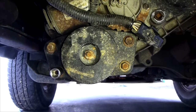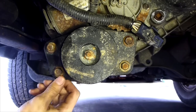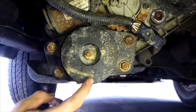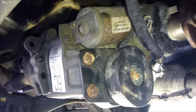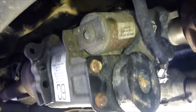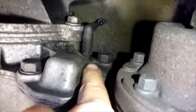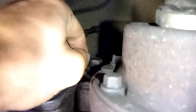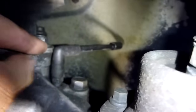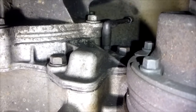So now we've changed out all the fluid — nice new fluid in there. Run it and see how it works; make sure you don't hear any noises and observe for any leaks. And that's how you change the transfer case fluid in a 4x4. One more thing — look at where your venting tube is and make sure it's still there, that it's not turned down, and that it's not clogged, because you don't want water to get in here. There's your vent tube going straight up and connected — that's what you want, facing upwards so water doesn't get in.